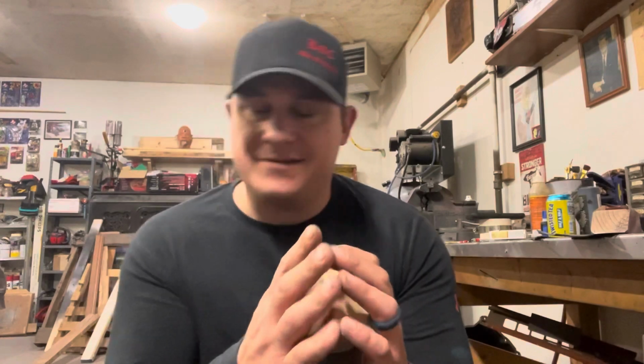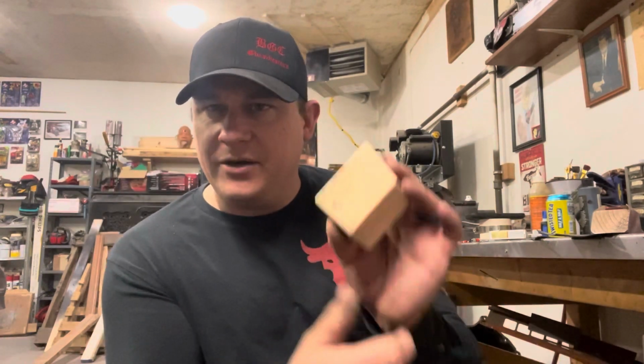It's just to give a nice finished look rather than something that's structurally stuck together with something else. If you're connecting two pieces together, Bondo is not what you need for that. It's not a two-part epoxy. It's a finishing agent to make something look nice. So I'm gonna get the Bondo out and then show you what it looks like with all the Bondo all over it.